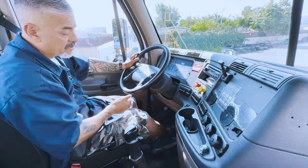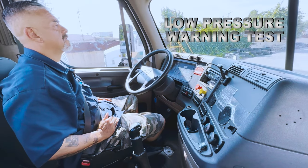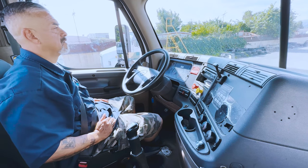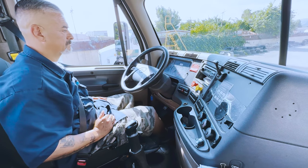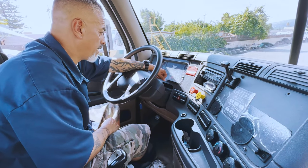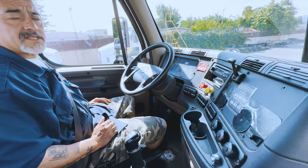Once you say it's a good test, that's when you release your service brake. My next test is my low pressure warning. I am looking for a warning light or a buzzer to come on, no lower than 55 PSIs. I am going to release some pressure. My warning light and my buzzer has come on — primary's at 63, secondary's at 67. This is a good test.